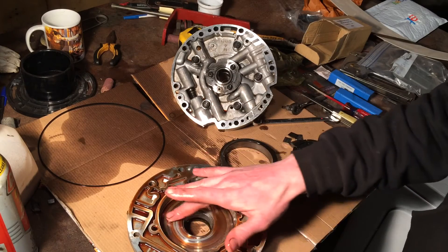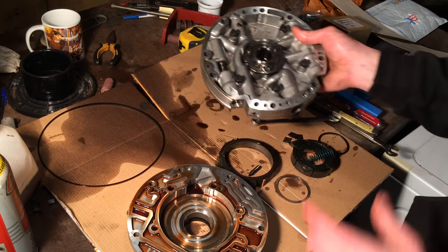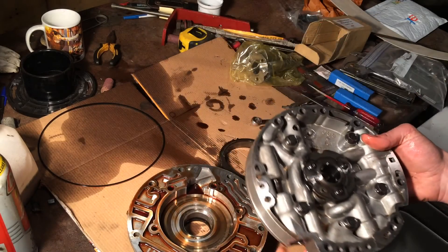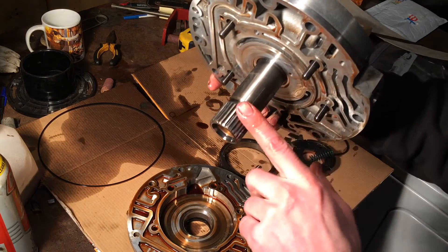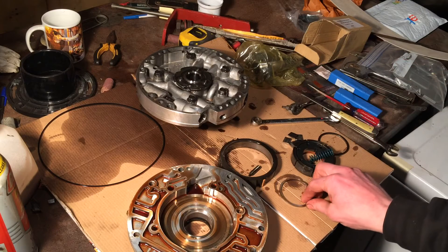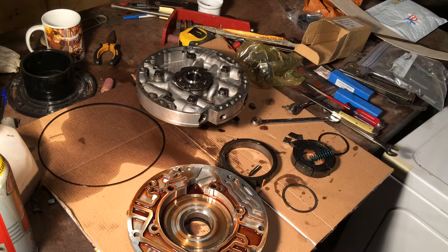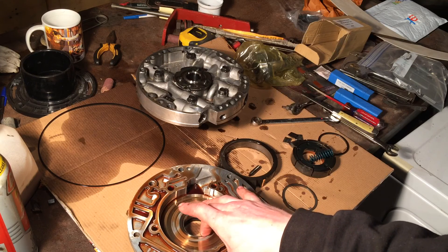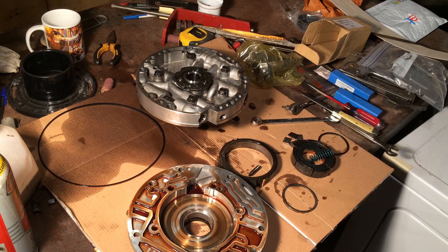That's about the basics — that's about as far as I'm going to tear it down. I may remove some of these valves; I think there's one up here too, but I don't want to get too involved. The next thing will be replacing this stator shaft. Also, there's an oil return hole that you have to drill out whenever you do this 10-vane conversion, so I'll be doing that too. I hope I've helped anyone who had questions — feel free to ask. The next episode should be either the bushing removal and install or the stator shaft replacement. Thanks for watching.